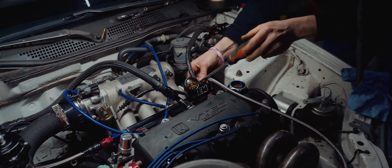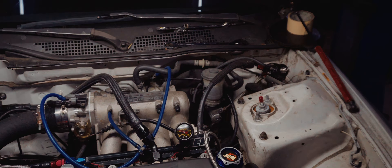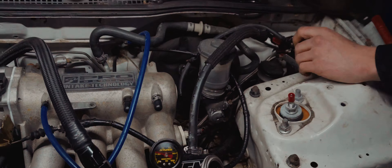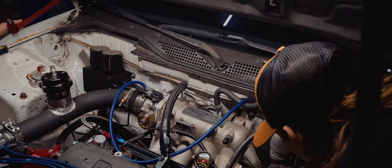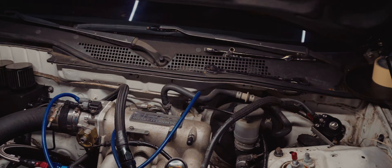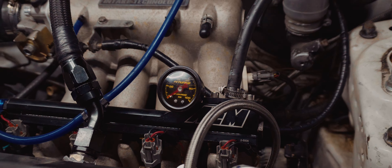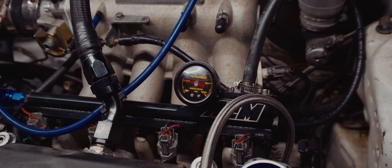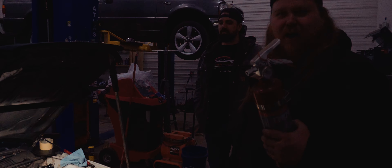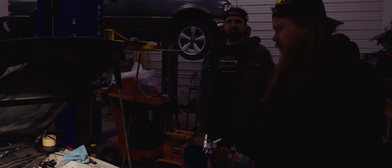Bathtub built baby. Take three. I'm crossing both my fingers. I heard fuel. Priming again. She's leaking down there now, at the bottom of this hose. Actually it's leaking on the return side now. The return side is leaking — that don't matter, don't have to run it anyway. Is the rail leaking up here? It bled to pressure. Prime it again? It's just dripping off. It's leaking up here — the injector's leaking. The second injector right there. Oh boy. About ready for the first fire. Got the fire extinguisher on hand just in case, cause we've been chasing fuel system leaks.